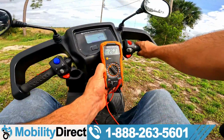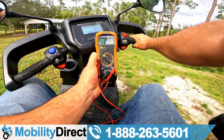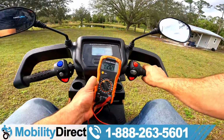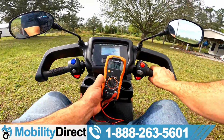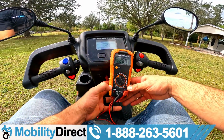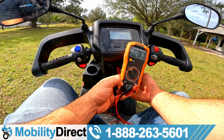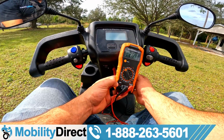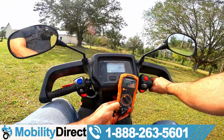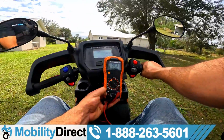24.9. Now when I was going faster, it went down to like 24.2 and then it cut out. So I wanna say maybe that's why it cut out at that exact moment. And okay, so now I'm getting the error 1 code again. So I'm gonna reset power, and I think personally, because dropping down low on an incline is pretty normal, right? It's really working a lot to try and get up that incline. I'm gonna test out the connections next.